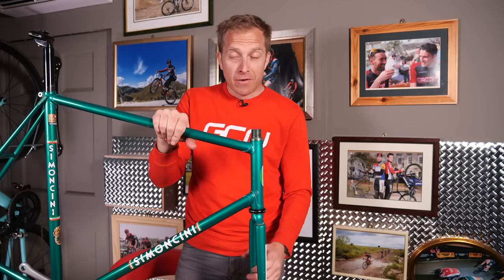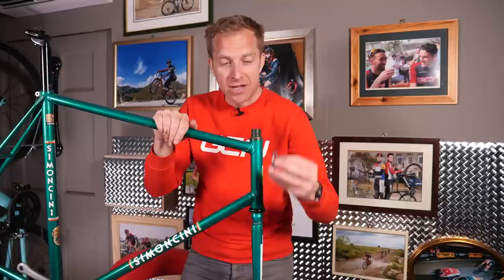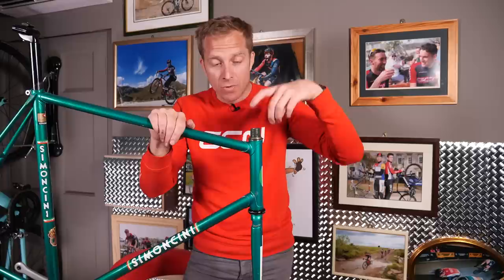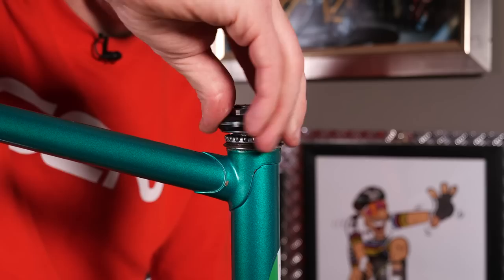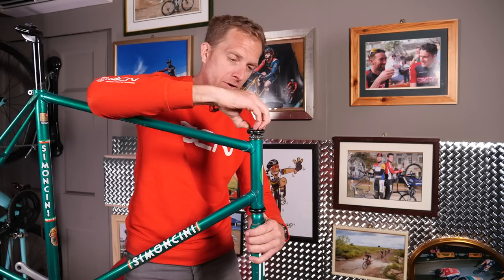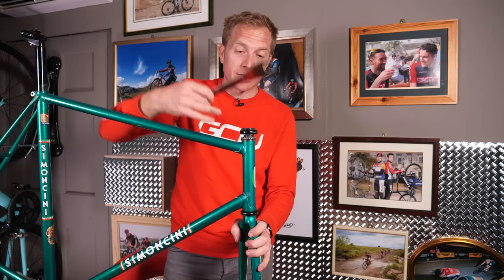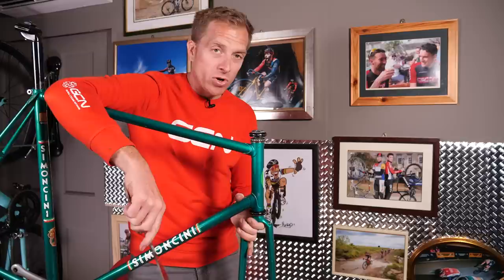The lower assembly is in there, but the jigsaw is nowhere near complete. Next, add the upper dust cover, then place the upper bearing on — I've already greased up the upper pressed cup to allow those bearings to rotate better. Then it's time for the upper bearing race, which threads onto the fork. Sometimes you need a little persuasion with a spanner; if you apply too much pressure, stop immediately as you're likely crossing the thread. Once tightened, apply the washers and then the locking nut.